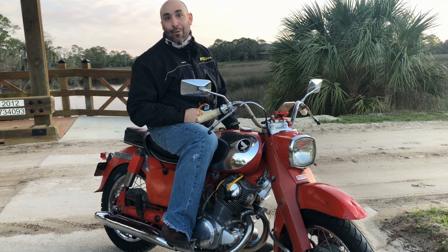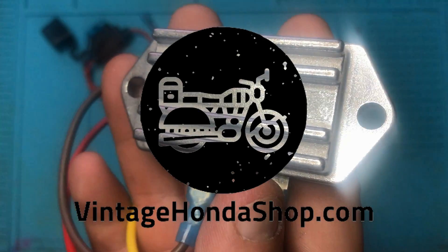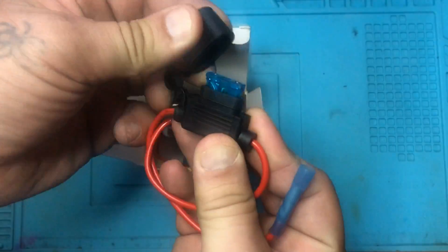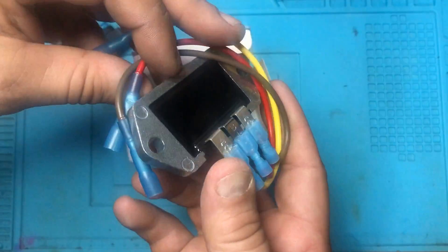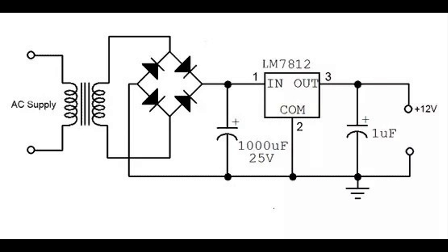Stick around, let me show you how it works. This is the VintageHondaShop.com 12-volt rectifier regulator for Honda motorcycles. It comes with a bladed fuse in a waterproof housing to eliminate the fragile stock glass fuses. It's robust in construction with large cooling fins and is pre-wired with waterproof connections for a truly painless installation.